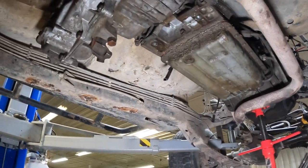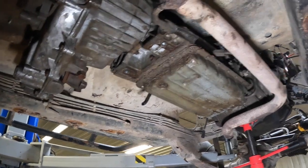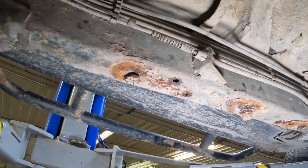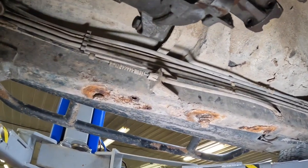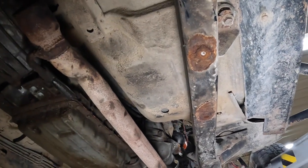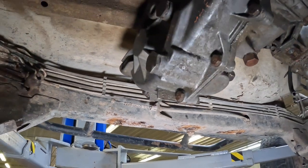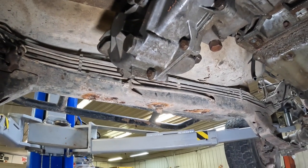All right, so there's going to be two main reasons why you're looking at this kit. One, your frame is going to rust out, obviously, in the center section. Or two, you've got a situation like ours where the bolts for the transfer case skid plate, you know, we didn't do this on this side. Someone actually repaired this by just threading a couple of bolts at the front and the rear through what was left of the frame, which is not great because it's very thin. But the bolts on the left side are still there because they pulled through the transfer case skid plate. Then on the right side, the front and the rear one pulled out, but the center one broke off. So essentially the nuts are up in the frame, and this one here actually is not even connected anywhere anymore up in there. So the reason we're installing this kit is really to get good transfer case mounting back and get this solid again.